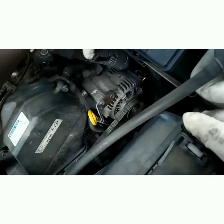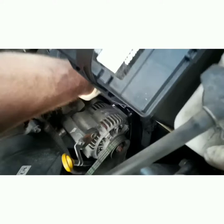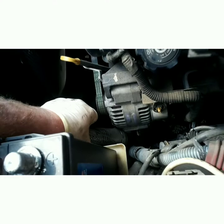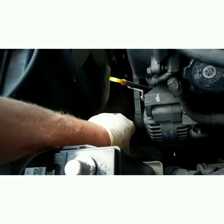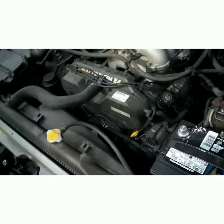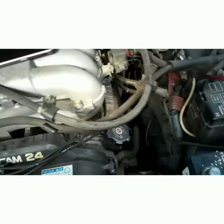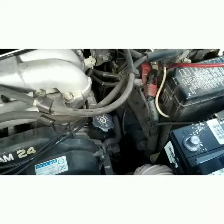Life's a lot easier if I can get the electric ratchet on there. There we go, that's a good angle — see the tension coming off that belt. I'm going to screw it out just far enough so we can take the belt off, and we're going to reuse that belt because it still looks fine. Get that bolt loose, a little pry bar action — boom, just like that. She's out.